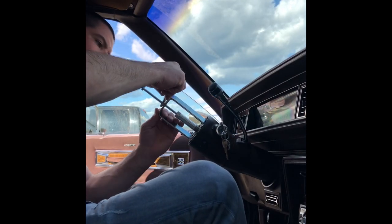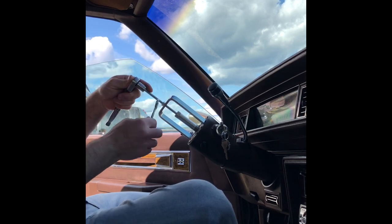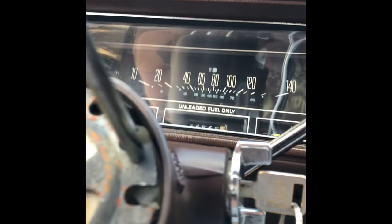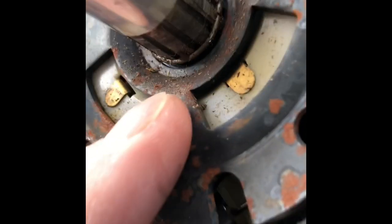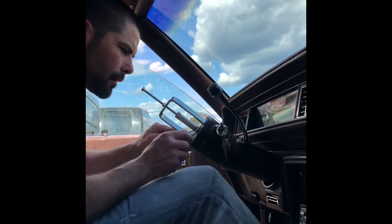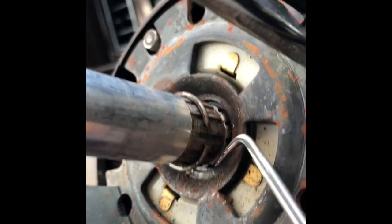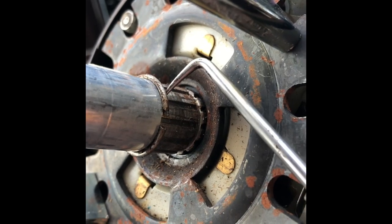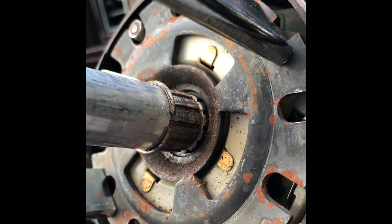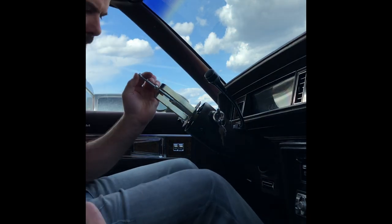Using a 13 millimeter, back this up so it doesn't spin. Now this outside metal plate is compressed enough — should be able to pick that ring out of there. Use basically one hand to hold it from moving and one to open it up and over. Just slide it on up — enough to take the tension off that plate — and work the c-clip up as high as it needs to go, because it'll just slide around the shaft. There we go.